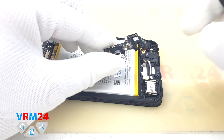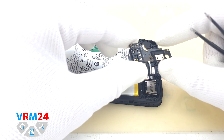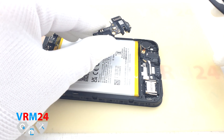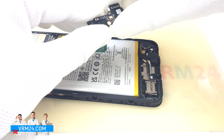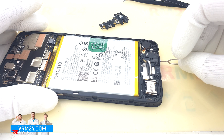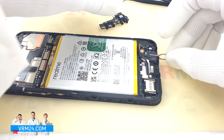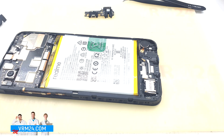As I said before, this is the microphone. How do we identify the microphone? We flip the board to the other side and see if there is a hole. We can also see that there is a hole for the microphone in the frame. If we put something in here — and actually there is a net — in general we would pierce the microphone net. The tool goes like this, the microphone is perpendicular, there is a hole here, and that means we won't damage anything.